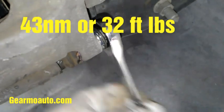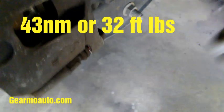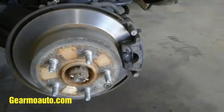Slide it in, push it in, and then tighten this down — I'll try to get some torque specs on screen as well. Then come over here and get this 13 millimeter nut back on, make sure it goes all the way down and tighten that down. That's it guys — double check everything, make sure your bolts are all tight, make sure your brake line isn't twisted or anything. Hope this video helped — please like, comment, subscribe, and any additional information in the comments is appreciated.